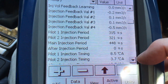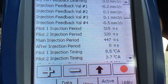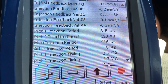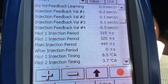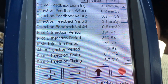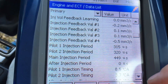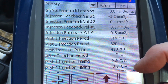Like other diesel systems, pilot one and pilot two stay fairly steady — that's what I expect to see. Main injection periods do jump up and down a bit. Once warm it moves around from about 400 to 450, occasionally a bit over 450, and hasn't gone under 400. Without looking it up, the spec is probably anything from just under 400 up to around 650 — that's from experience working on vehicles.